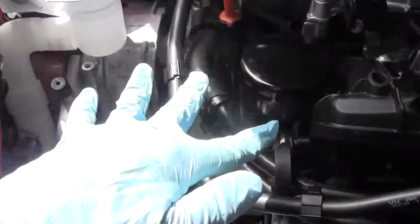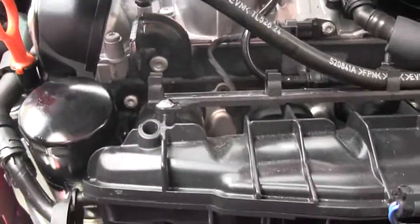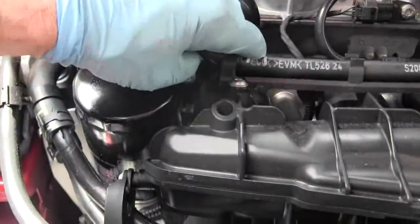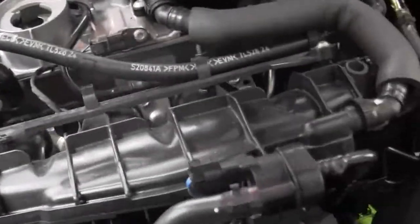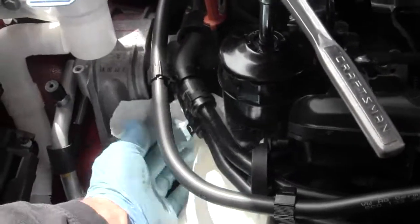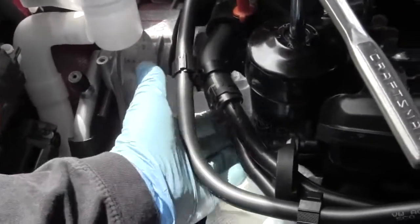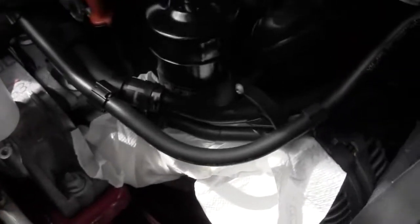Coming at you with the oil change — we're at the oil filter at this point. I'll move the oil filter wrench out of my way. This rubber hose is snapped down into these snap-downs on top of the oil filter. What you want to do is take it out — I already had done it — and stick it out behind the oil dipstick like that. Now your oil filter is ready to come off. The wrench is proper, so start loosening it. Make sure you put your rags underneath it because sometimes oil will come out and start leaking down — so you don't get it on your alternator belt.